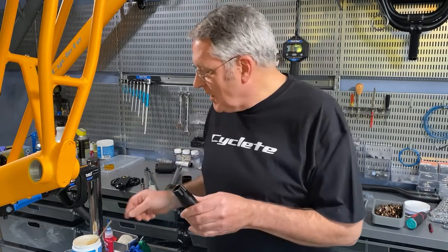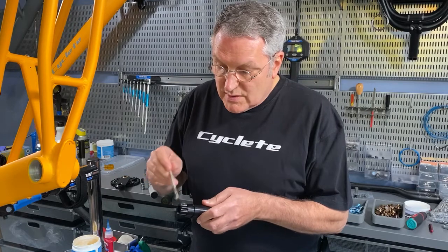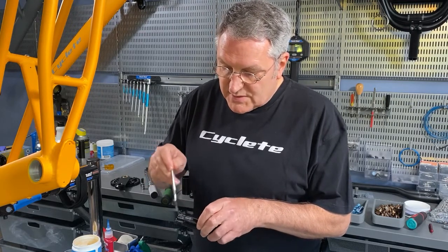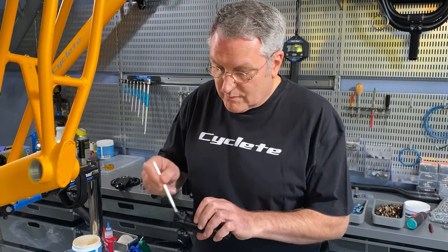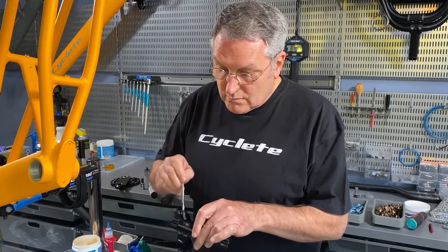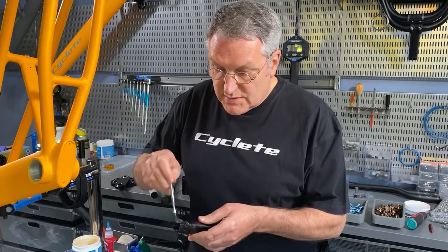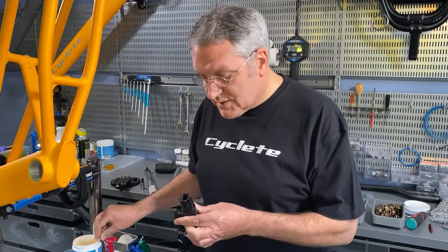So we begin by applying our grease. We use this white lithium clear grease on the spindle, the tapered lobes, and the surface that the bearings will ride upon. It's not there to let the bearings slide, but rather to let the bearings seat properly when doing assembly. I'll do that on the other side. And that lets the tapered lobes seat fully and lets the bearings seat properly. So, a little light grease. I will set this aside.